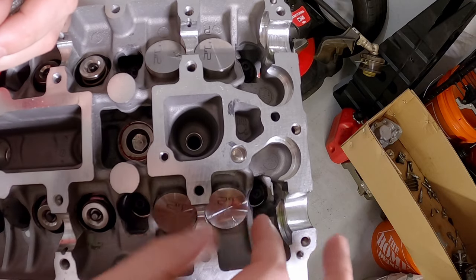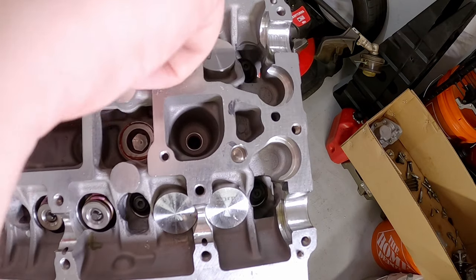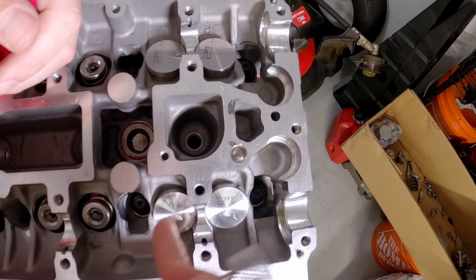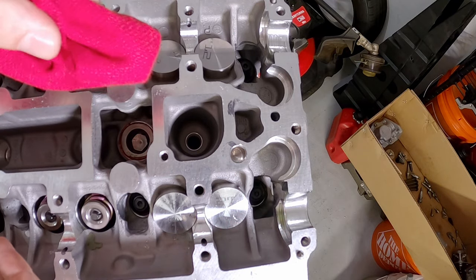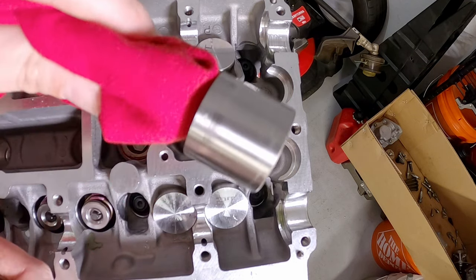I'm going to real quick go ahead and rip all those out of the bags, get them in place, get the cam caps back on — the cams, the cam caps back on. We'll go ahead and check our final measurements and hopefully we did okay. Cross fingers, toes, whatever. Quick tech tip: getting these in and out can be tricky, trying to pick them up with your fingers. The best way to do it is with a magnet. However, I don't like using the magnet by itself because if it's a piece you're going to reuse, you don't want to mess up the surface. So what I do is take a rag, put the magnet over it, and that way I can just lift it up and out without any damage, not scratching anything. There's my little tech tip for the day.